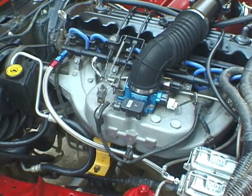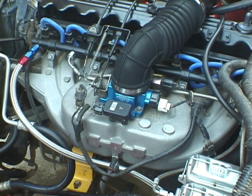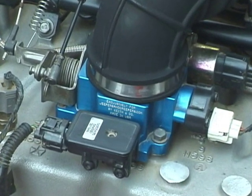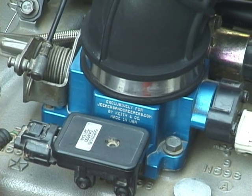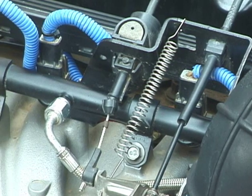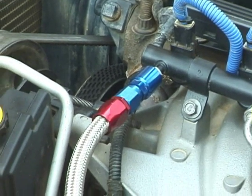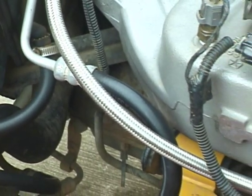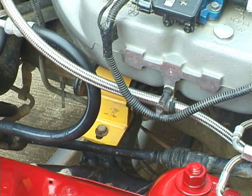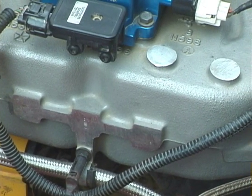On the driver's side you can see the intake — it has been welded up. There's no longer any pull from the EGR or brake booster. This is the Jeepers and Creepers 62mm throttle body, CNC machined out of a solid piece of aluminum. You can see the throttle spring there, and another shot of the Mustang 5-liter fuel injectors. There's an EFI fitting going to a half-inch inside diameter stainless steel braided fuel line that runs to the back with an inline filter. There are the Brown Dog motor mounts, and a great shot of the professionally welded-up intake.